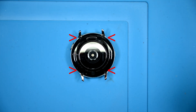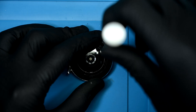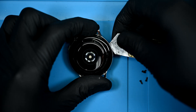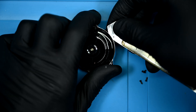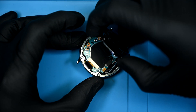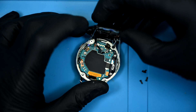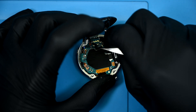At the bottom there are four tri-wing screws that secure the back panel and pulse scanner. After those are removed, I'll use the metal pry tool to separate the back panel from the frame. I'm honestly not sure what this material is, but having opened Moto 360s in the past, I know this shiny stuff is pretty breakable. You can see the stringy silicone adhesive pulling away. Check where the ribbon runs before you fully lift it up — I'll need to disconnect this first.